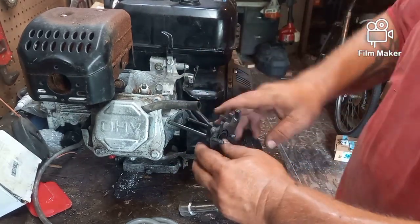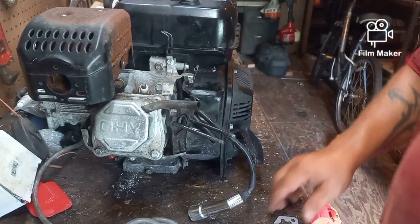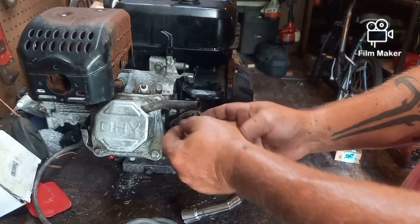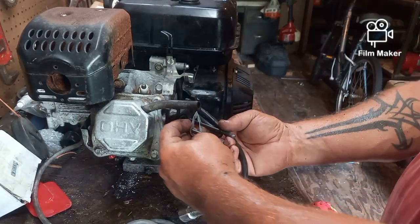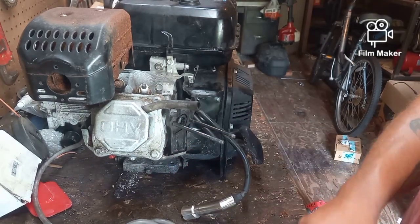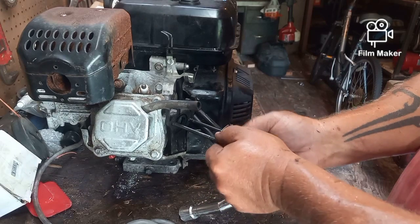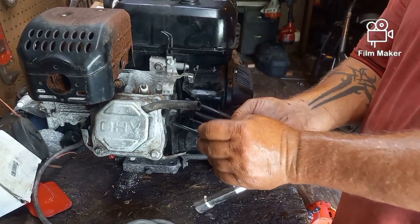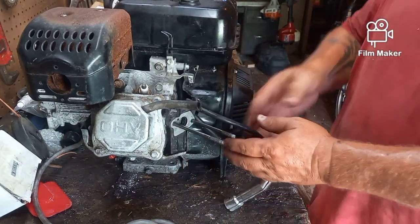We have our gasket on in the back. We're going to push this slug plate up there. We're going to put the next gasket on, if I can. Oh, that's the wrong one. That's the one with the little hole on the top. Because what's important is not getting any air between the carburetor and the intake manifold.